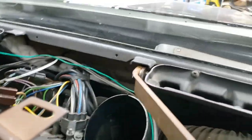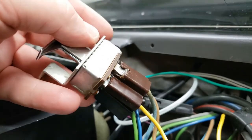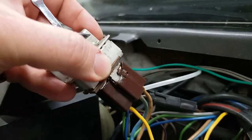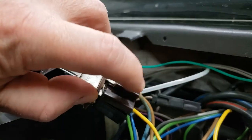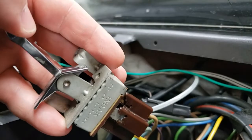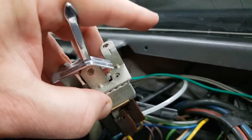I'm really big about making sure you put dielectric grease on your connections — all your wiring connections, no matter where they are. It's just cheap insurance. Since you're going to put things back together, make sure you get real good contact — whatever work you do, you really don't want to do it again. I had been in here before to see if maybe the wiring was part of the problem before I discovered that pushing the switch to the side turned the motor back on. I traced all the wiring down and it was all good — that's when I finally stumbled across that pushing on the switch made it come on.